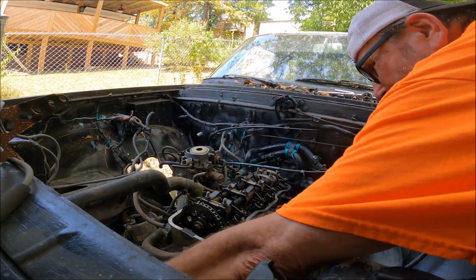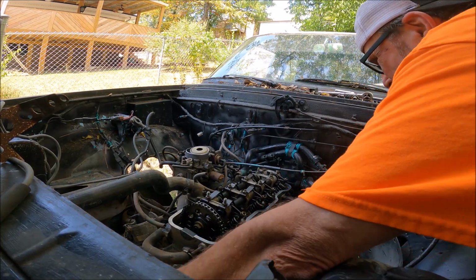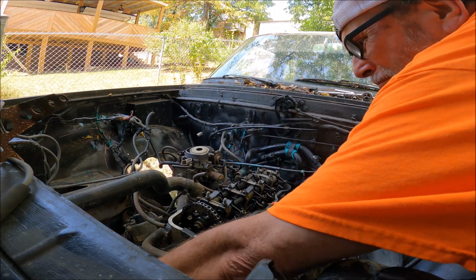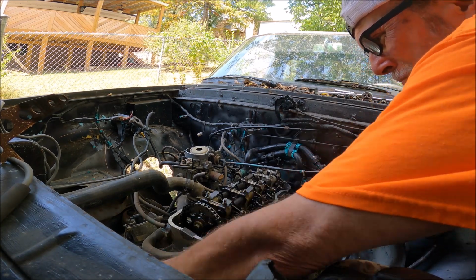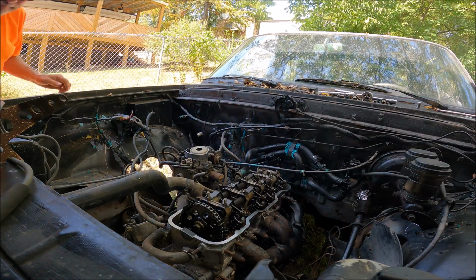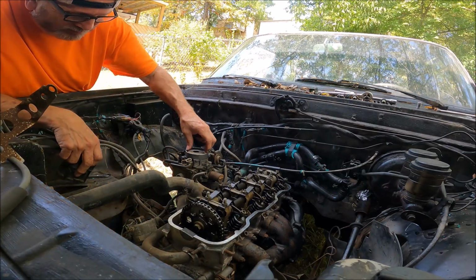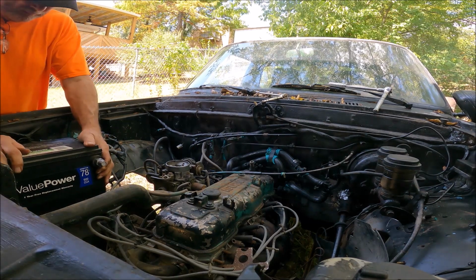So I rotated the crankshaft and watched the valves. I wanted to be real sure I was at top dead center on number 1. The engine seems to have pretty good compression too. For a starting point, I set the crank pulley at 0 degrees. I set the distributor so the points would be open when the rotor pointed at number 1. This was really just a starting point. I thought we'd get it to fire at this point, but it should really be at 6 degrees, not 0.